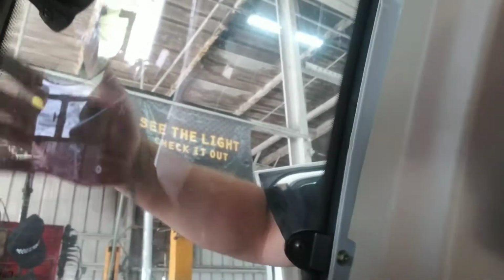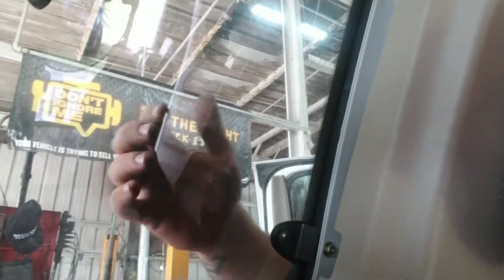It kind of sucks once you get the panel all popped off. It's got tension on those screws, and you're trying to get them undone. Go ahead and pull those screws. And be careful, because this window is going to be relaxed. But don't try to push it out. You don't want to pop it or bust your glass. It's not likely, but it could happen. So just be careful with your glass. Let me get this stuff off and we'll continue.